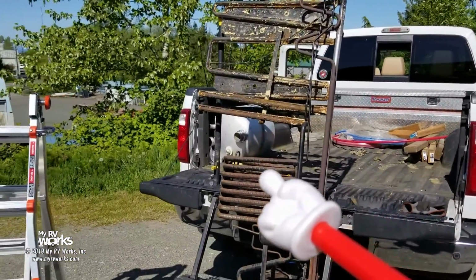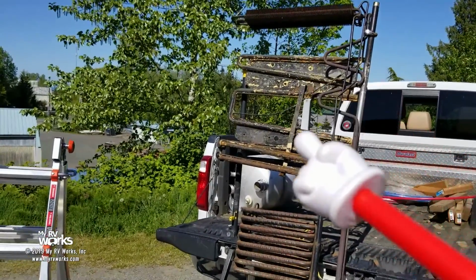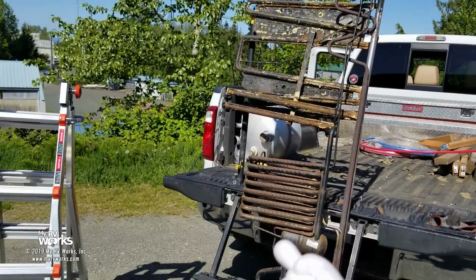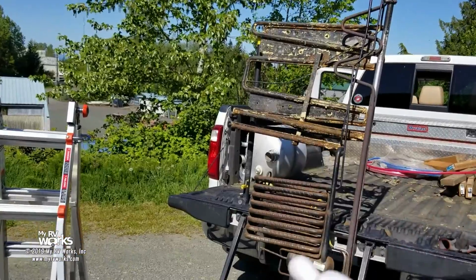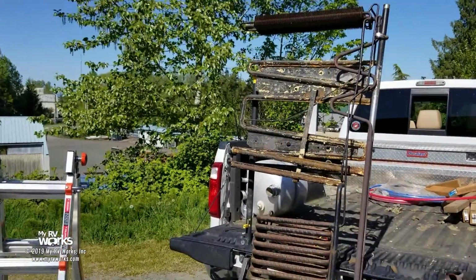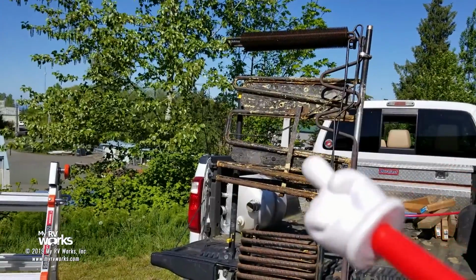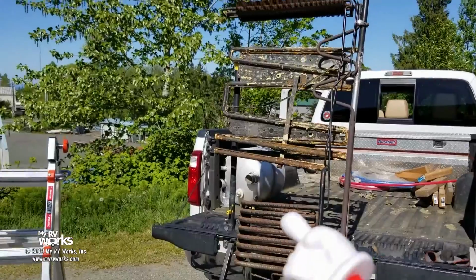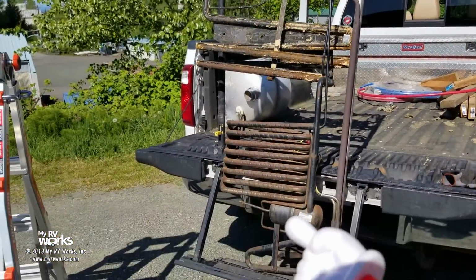Then we have another heat exchanger, which is a liquid heat exchanger. This is where all the heat that it absorbed up here is absorbed into the water, and that's why it's so important to have ventilation off the backside of your cooling unit to scrub that heat off. So there are 4 steps the ammonia goes through: liquid, vapor, and 2 heat exchangers: gas heat exchanger, liquid heat exchanger.